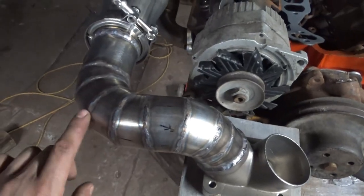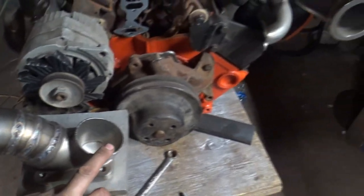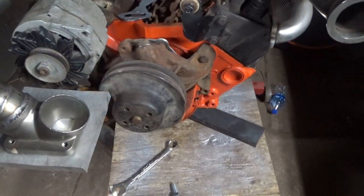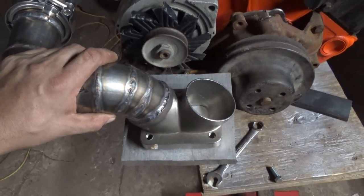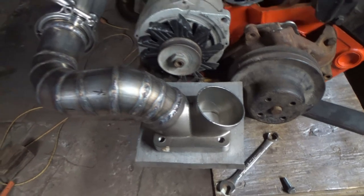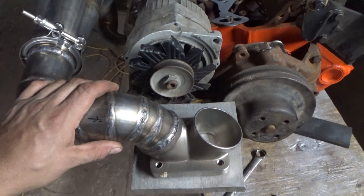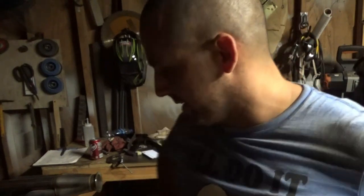For the wastegate I'm going to use a hole saw and put the wastegate right here pointing this way on both sides. This side is going to get a bellow so it'll be a lot easier. I am going to have to move my bracket a little bit because my pipes moved. Whenever you have gaps and the fit is not good, that obviously makes your pipes move more when you weld them out. I had enough for today — if you found this video helpful, entertaining, or inspiring please like and subscribe.